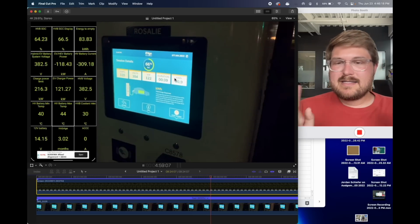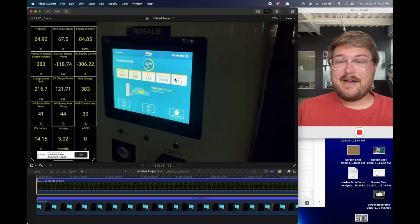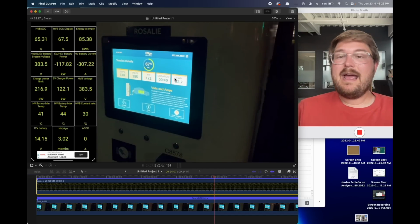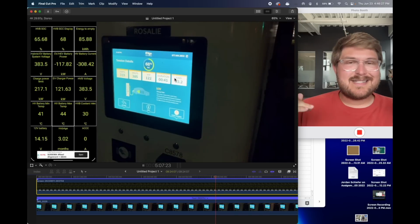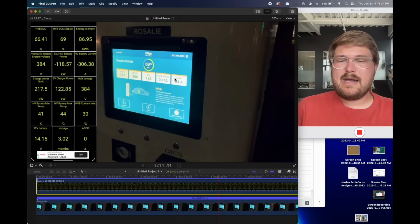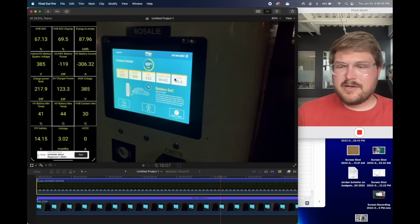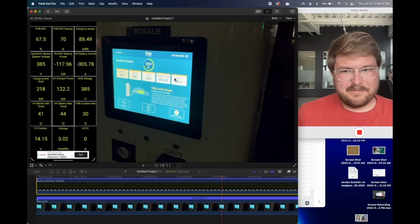There's one last thing to consider here, while we're just having a very consistent charging situation right now, and that is towing. When you're towing, the range is significantly decreased. And it's all based on the aero profile of the trailer and some weight impact, especially if hills are involved. And we've done all those tests. When you're towing, you need to charge deep into the battery pack.